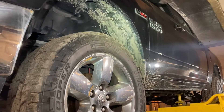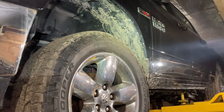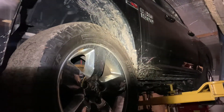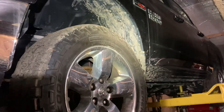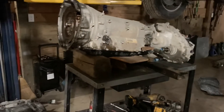I've come across this before — you may or may not get that trouble code, but on your scan tool you can graph it out and watch the signal from the crankshaft sensor. It should be a very steady signal. If you see a periodic dip, there's a good chance the reluctor ring for the crankshaft sensor is faulty.